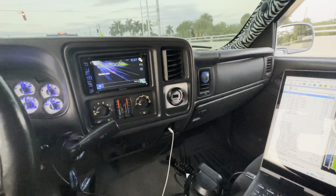So I just checked and there's probably some percent error, but my phone shows 42 and the truck shows 44, 45. So either the tune's a little off, my phone is incorrect, or the gauge would be correct. The only other thing would be if that needle isn't perfectly where it needs to be, like it probably could be pushed down a little bit more, because what's weird is it doesn't know where zero is, it just knows where its starting point is. So if you make the starting point 10 miles an hour, when you turn the truck off, it sits at 10. If you take the whole thing apart and push it up to 10 miles an hour while the truck's off, you start it up, it's always gonna go back to 10 miles an hour because it doesn't know where zero actually is. So that could also be a little bit off, it probably could be brought down a little bit, and maybe that would give me the perfect mile an hour. I don't know. But it's close enough for driving around and getting all that stuff done.